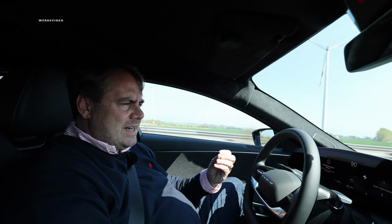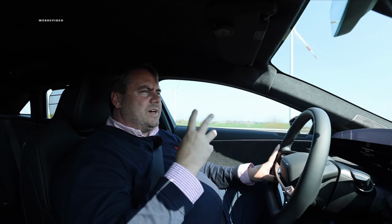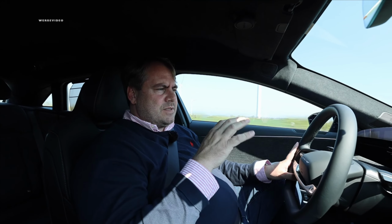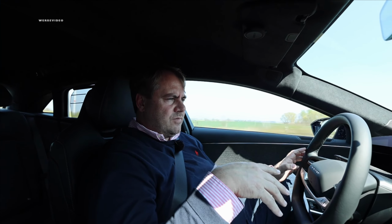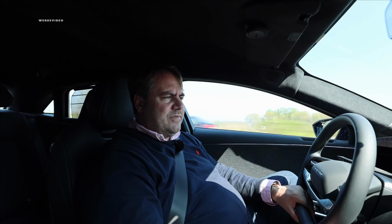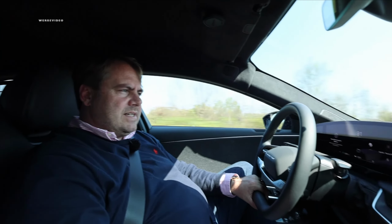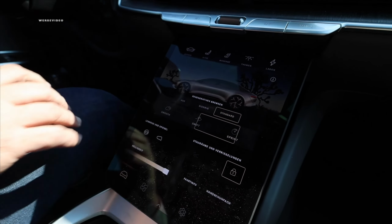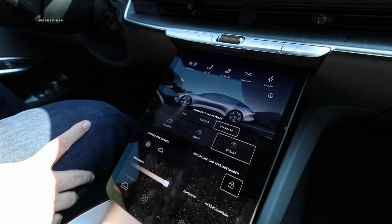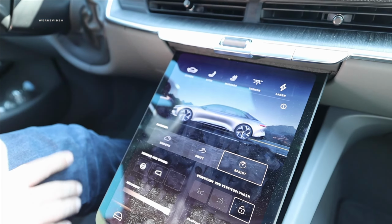We have an adaptive suspension system here, meaning the dampers can be adjusted in terms of their stiffness or softness accordingly. The car does this completely automatically. I haven't found any manual adjustment options here either, except for the 3 driving modes you can see. Smooth, where we've been driving the whole time with the consumption displayed. Then there's Swift, or of course Sprint, if you want to draw the full 325 kilowatts of maximum available power out of the battery pack.